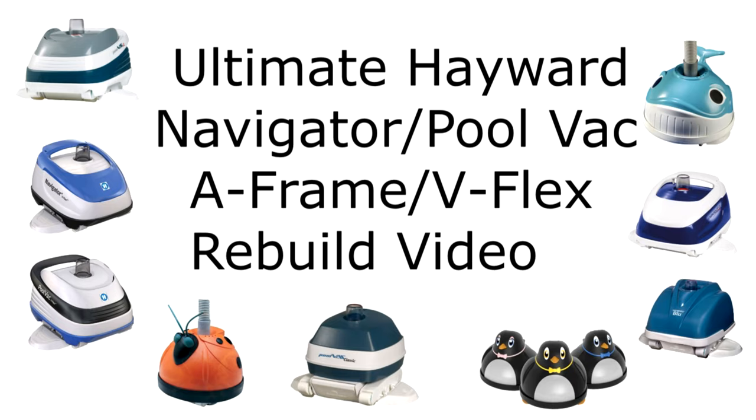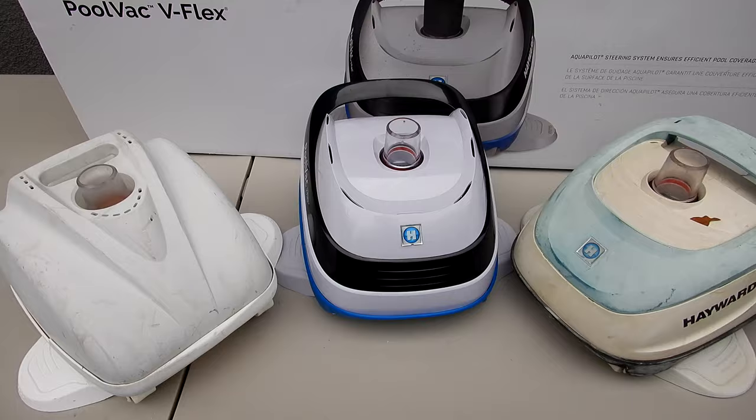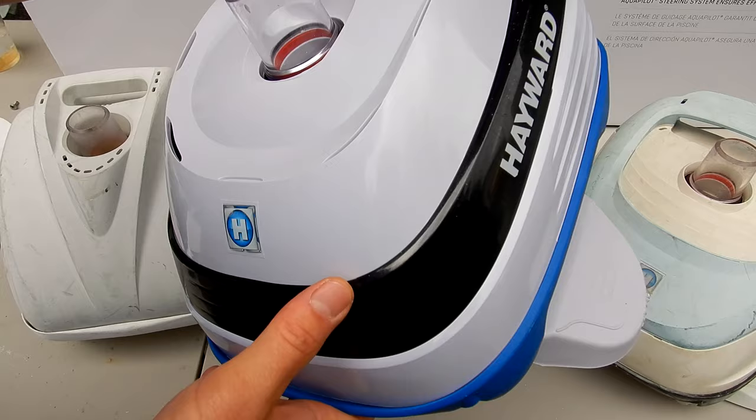In this video I'm going to show you how to get your Hayward Navigator or Hayward PoolVac moving again in your pool. And if you find your Hayward Navigator is not moving in the pool, more than likely it's the A-Frame Turbine, or if you have the V-Flex Navigator or PoolVac, it's probably the V-Flex Turbine that's worn out.